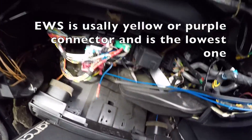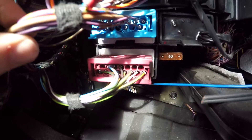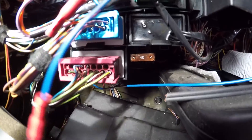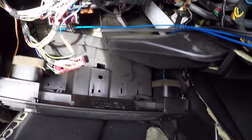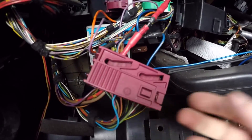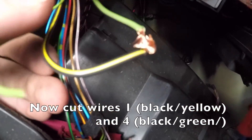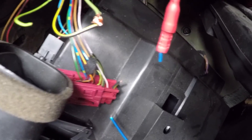With the glove box removed, you've got access to all your glove box modules, and the EWS one is this — it's going to vary on what color yours is. This is EWS2, but it's this kind of pinky purple one at the bottom. Just pull it out, and before starting messing with this, obviously disconnect your battery. It's a sliding style connection, so you just slide it all the way to the left to remove it. That wire's cut now — obviously you need to tape up the ends. Black and yellow, black and green are bridged. Now tape all the way over the ends so they're not hitting against each other.